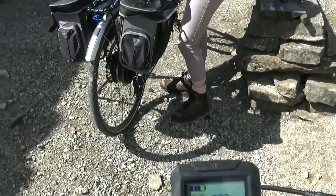Now, the way these bikes work is that you can't just sit on them and press a button and go. You have to work. You pedal, and the mechanism is like a torque reaction system. Whatever you're putting in pedal push power, the electrics chips in a bit more, so it's like a torque amplifier effect, if you like. And depending which power mode you're in, it puts in more or less power to amplify the effort that you're already putting in. They're legally limited to 25 km an hour, or is it 25.5? In any case, that works out about 15 miles per hour, and believe me, when you're pedaling along a road at 15 miles per hour, that just feels like a good old lick on a bicycle.